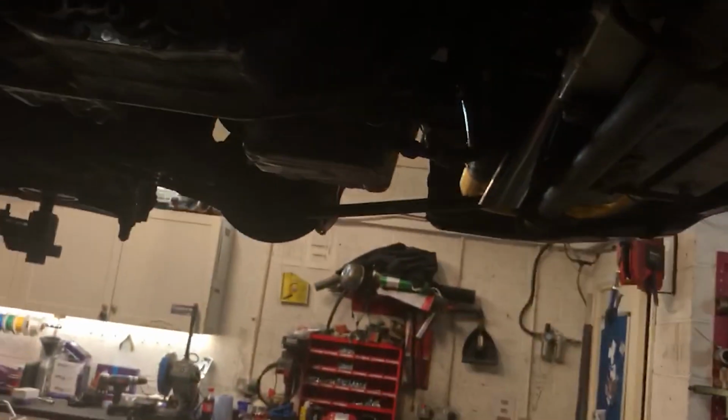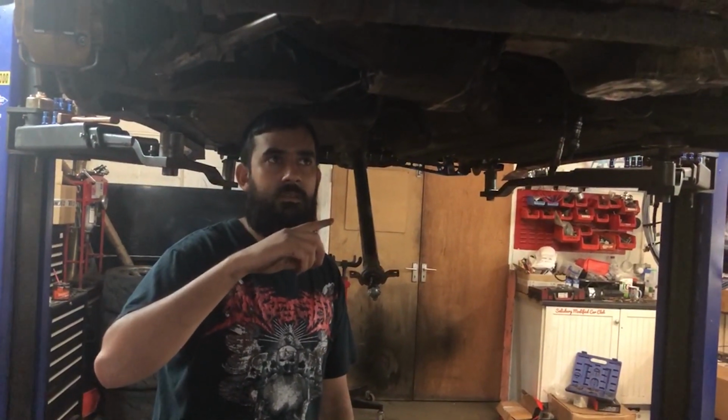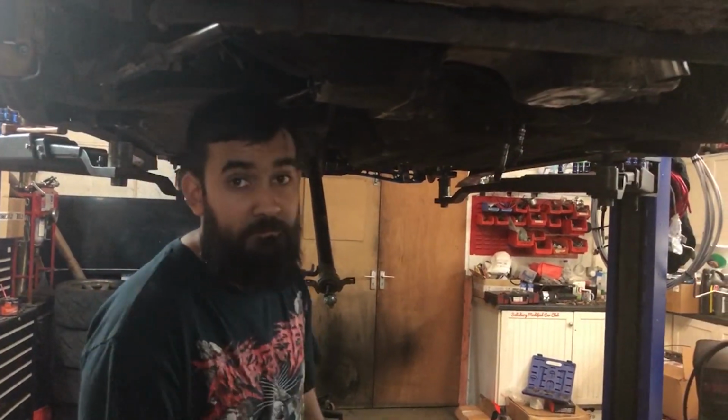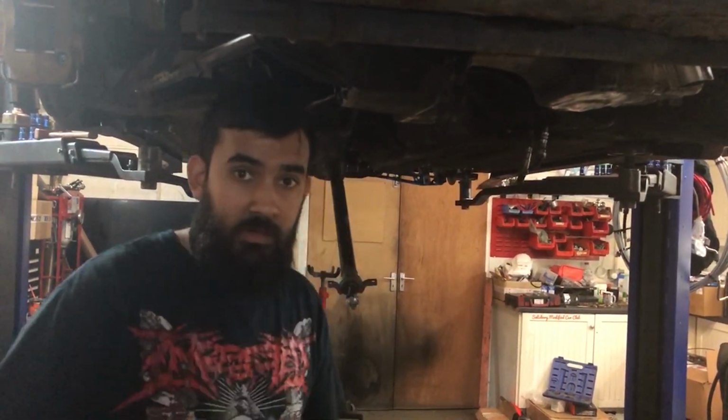Front end wasn't really a huge amount of modifying, was it? We obviously had different engine mounts. We had to use Hasport all-wheel drive mounts, because the gearbox mount was slightly different. The rear mount, I think, yeah, it was the rear, was slightly different. So, I think that's it. It's getting there. Today we've just got to do the shifter and cables. Yeah, we've got shifting cables.